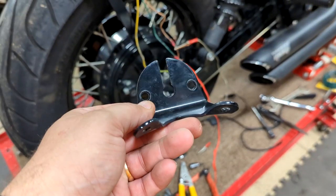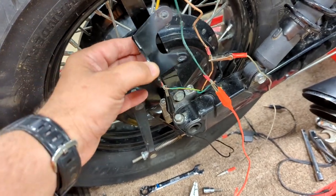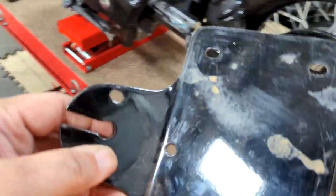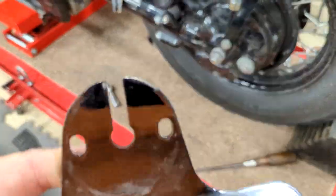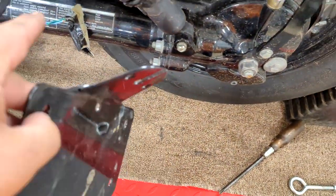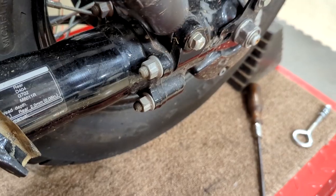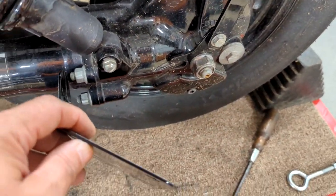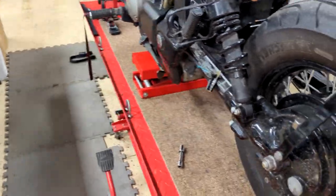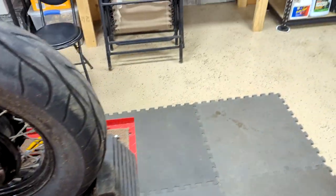In theory I'd like to reshape the bracket for the taillight assembly to fit over here. I picked up a generic tag bracket because the other tag bracket has a really funky piece on it. I'm considering cutting it off, redrilling the holes, bending it to a 90-degree angle, and maybe putting it right here where the two nuts go into the swing arm. Keep in mind I don't know Honda, so don't give me grief about calling parts by the wrong name. We may be able to make the generic tag bracket work a lot easier.